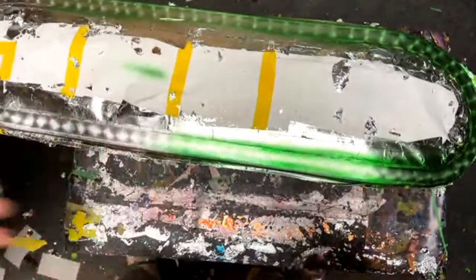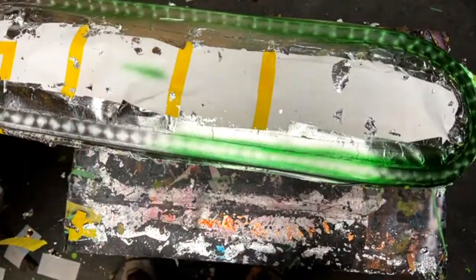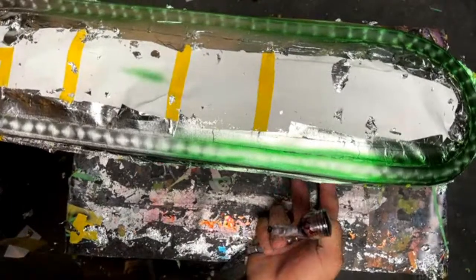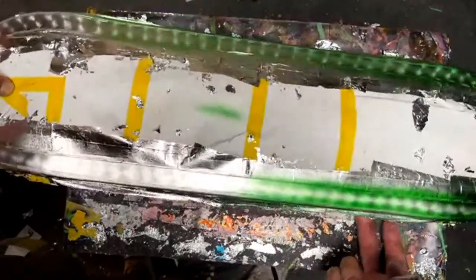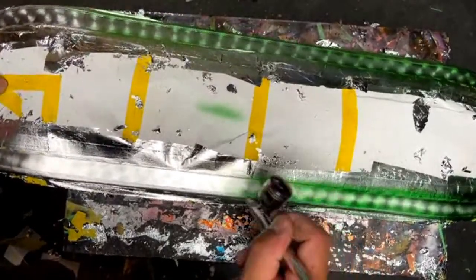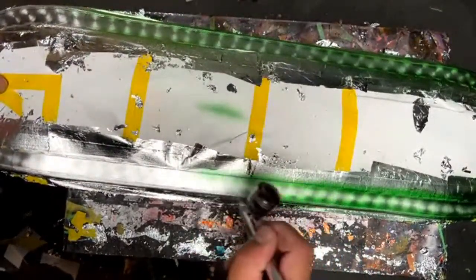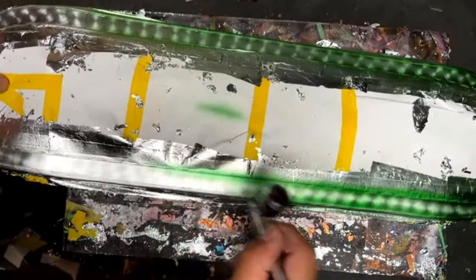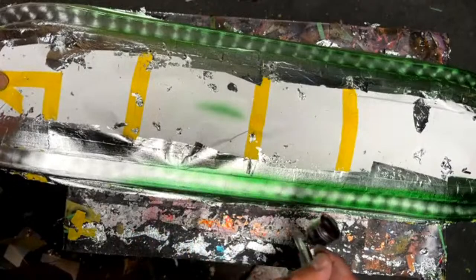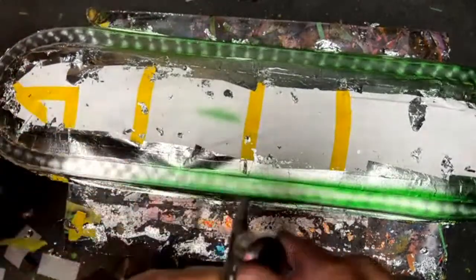I mean, you don't want to spray the candy straight. You don't want to reduce it and spray it straight. You could have some adhesion problems with that, because clear base coat, inner coat clear is also known as binder, which binds things together. So you need that portion in the mixture to make sure everything is going to stay solid and stick.